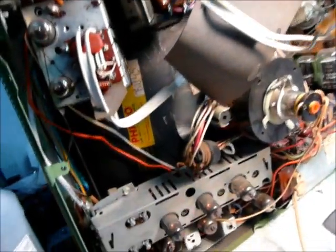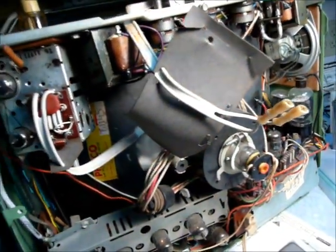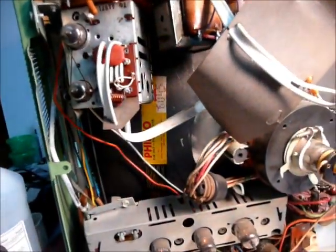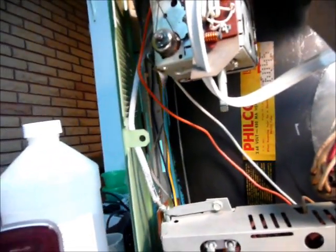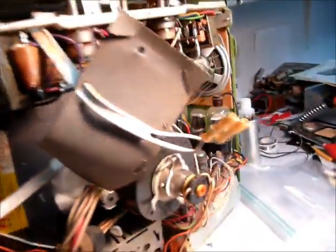The filters are buried behind the chassis up against the picture tube — you can't easily get to them. Some of the DAG is going off the edge of the CRT and reflecting on the inside of the set. Deflection is just about full — about an inch and a half from the bottom all the way to the top, and full all the way across — no signal hooked to it yet, but that's a good start.